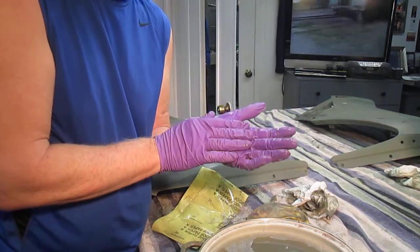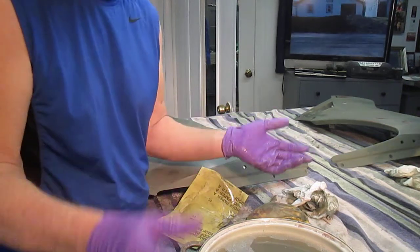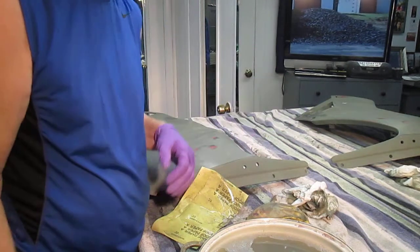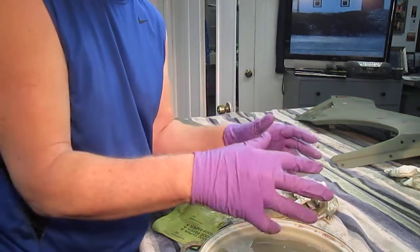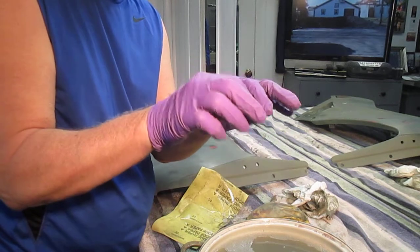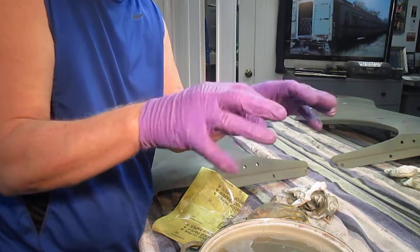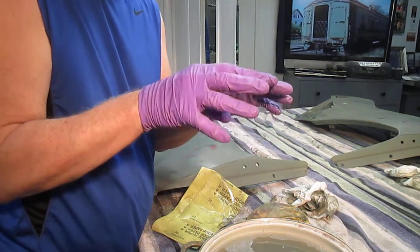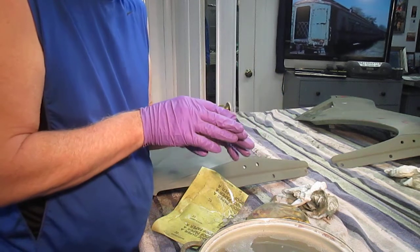If it's not flat, any little thing, any mistake you see here, yeah, you can cover it with green, it's going to show through the green. Then you cover it with clear, it's going to show through the clear. Then you put the bike out in the sun on a hot day, and that part is going to, of course, paint is alive, it's constantly changing. From temperature and humidity and everything, it's always moving just a little bit.